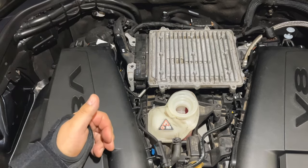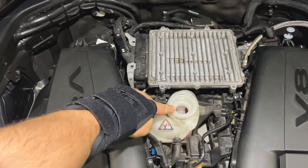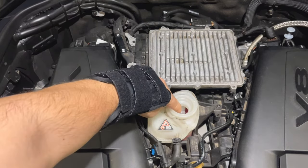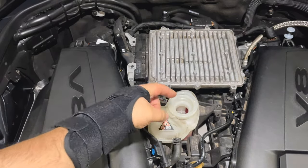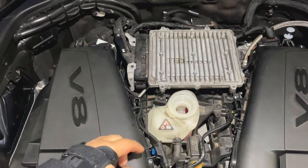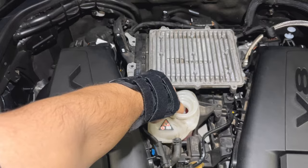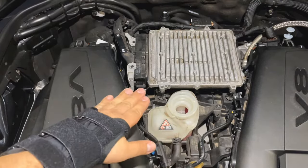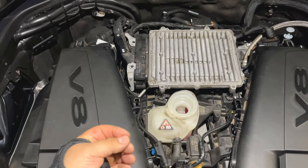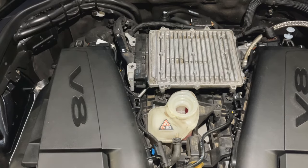We need to know where the level is — if we have to fill it up, if we need to add coolant. Right now I need to add some coolant. I haven't done it in a while, but see that little piece there, that piece of plastic that has like a little cross almost. That's the level. It should be flush with that when the engine is cold. If the temperature is warm, you can expect a little more of it.